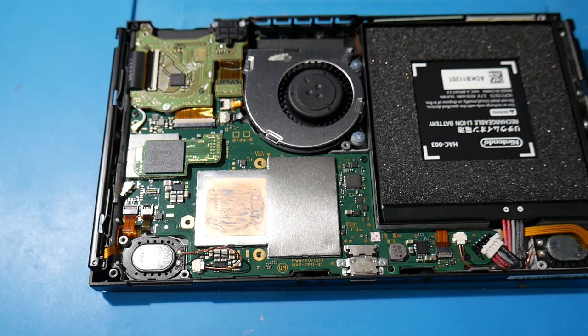Once the SOC is clean, shiny, and free of old thermal paste, take fresh new thermal paste and apply it. I'm using Arctic MX4 — not necessarily the best, but it's worked well for me. I like to put a small glob on and let it spread evenly across the die when everything is pressurized back together — I don't spread it manually. Before reassembling, clean the heat spreader too — both the top and bottom — using q-tips and isopropyl alcohol. Do not reuse old thermal paste.